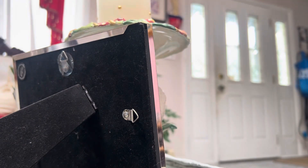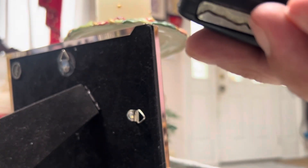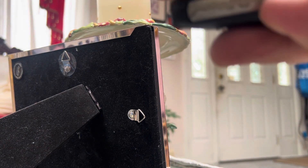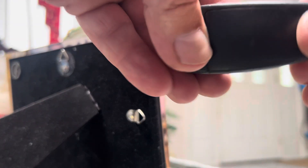It's a CR2032. Put the battery back in — it just places in and doesn't fall out. You have your connections here where it makes contact. If they were dirty, you could clean that with a Q-tip and a little alcohol to make good contact. So you put the battery in and snap the cover back in place, making sure it's making contact and snapping the cover on nice and tight.